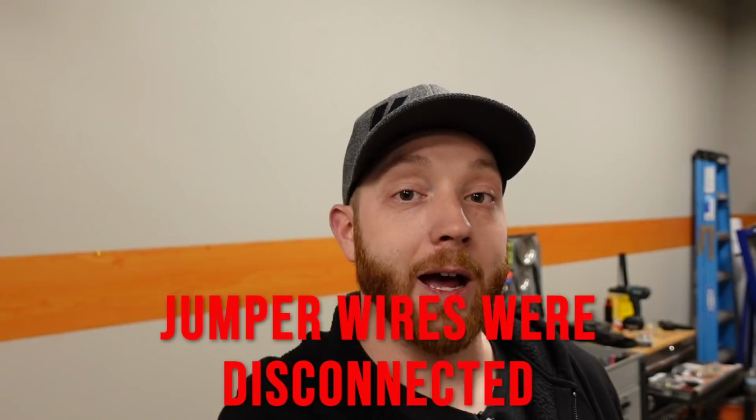So I came back here and then I scanned for codes once again because I was just curious about that range position, the 706 code. And weirdly enough, it did not come back. Now, I don't know if that's just a fluke. I don't know if after completing the crank relearn that somehow tricked something. I don't know if the PRNDL flag in the tune, I mean, I don't know what's going on. I can't explain that. But after that 15 or 20 mile drive, everything worked perfectly, no codes, and the thing drives perfectly. The computer also knows what gear it's in because I can log that on the scanner. It shows when it shifts, what gear it's in, and everything like that.